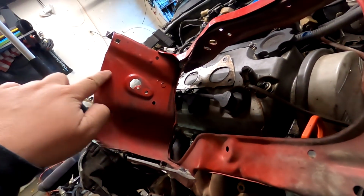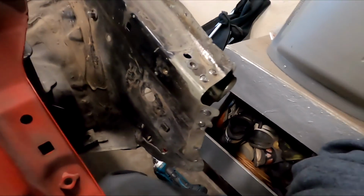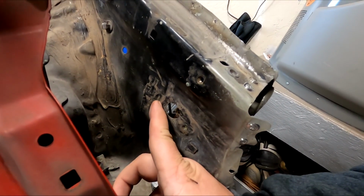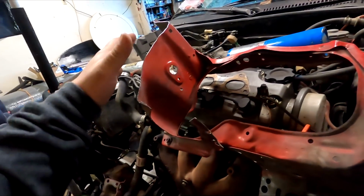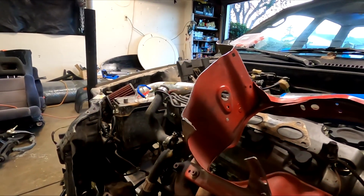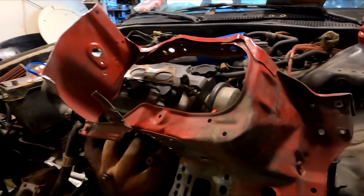So what I'm gonna do is, this is obviously cut about 2 inches after the hole, right? On this side, I think I'm gonna trim down maybe 1 inch after the hole, or maybe even just right after the hole right here instead of all the way over here, because we need it to overlay. What I want to do is overlay instead of trying to butt it up the first shot and potentially undercutting and then not getting this thing to fit right with all the gaps.